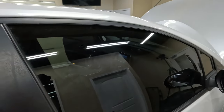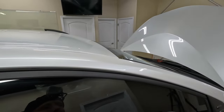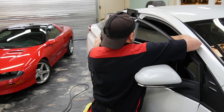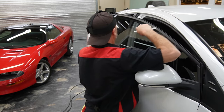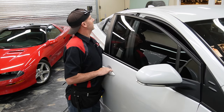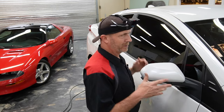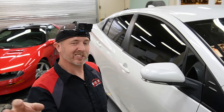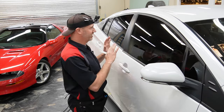I'm running over a brighter area of the room and just looking in the section where that door is in my view — looking for any silver dots. There's a little tiny lint there, and I like to get every one of these if I can. A lot of people or some shops will probably just leave that — they're not going to put this much effort into it. But for a couple minutes worth of time you get a much cleaner install, and your customer never finds an imperfection in your install. That doesn't mean they aren't there, it just means that you hit them — because perfect isn't a thing. I can honestly say I've done just a couple of truly perfect windows in my career — zero problems — and only a couple of times did I have a window where there was zero touching I had to do after the install.